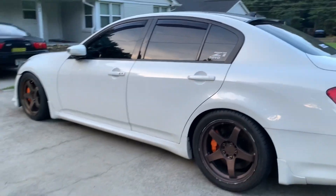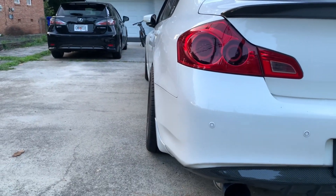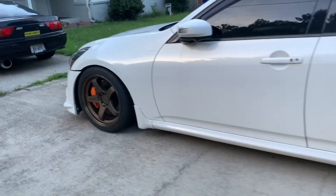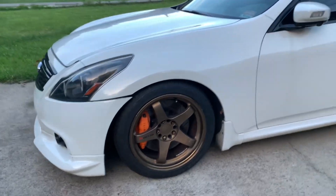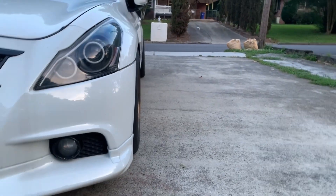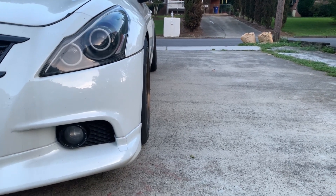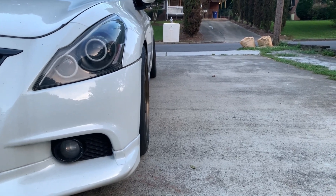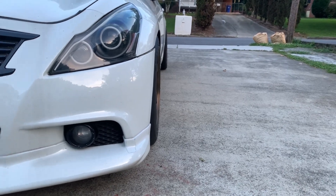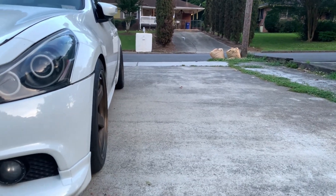They're both 26-inch diameter tires, so they're matching. One of the reasons I wanted to run a staggered tire setup on a square wheel is because generally when you run on the narrow side of a rim, it increases the stiffness because it pulls the tire — so it helps with steering response and improves front-end stiffness of the wheel and tire setup, as opposed to a 285 on a nine and a half.